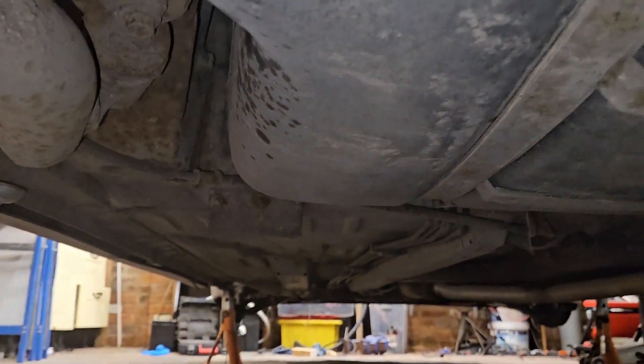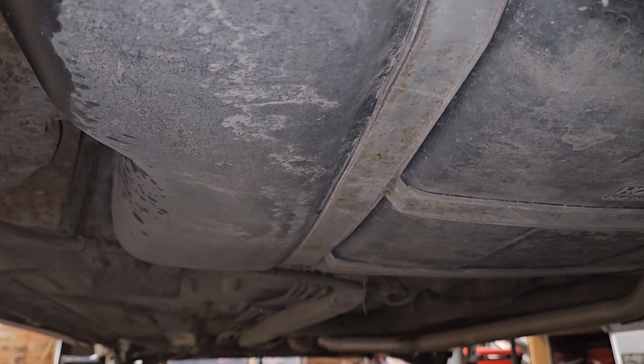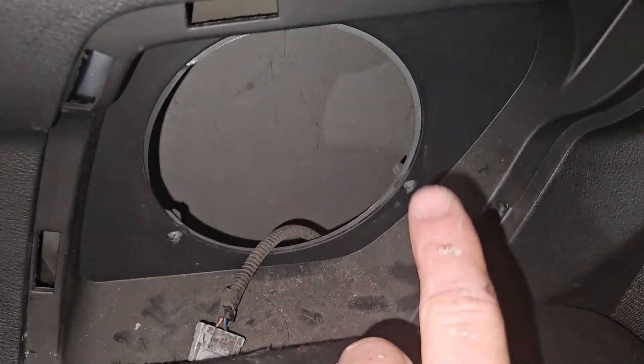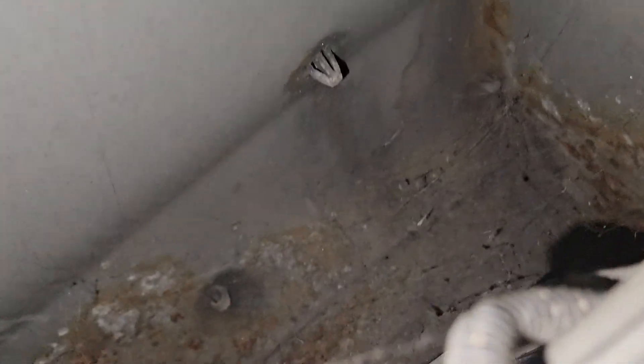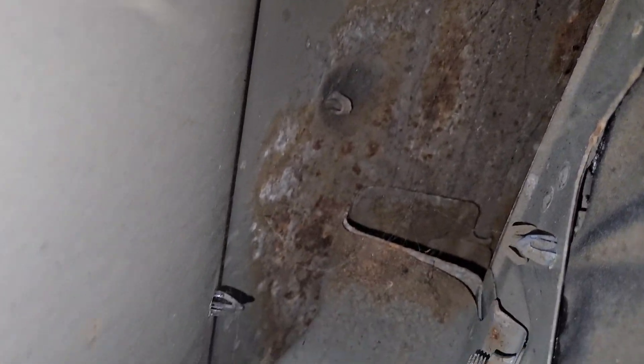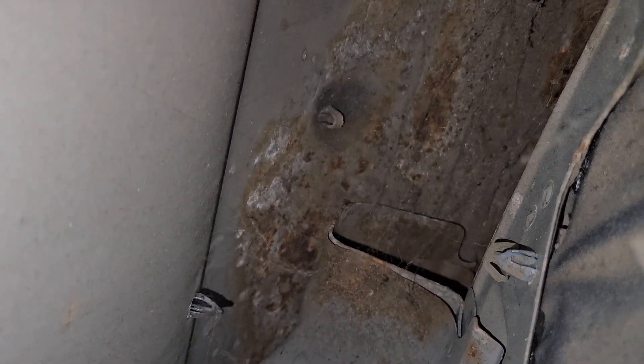It looks like we haven't bought a dog, so let's put the camera in the speaker holes and see how they look. For those unaware, one of the key places to look on an EP3 Civic is behind the speakers — you take the cover off, three screws, turn your torch and camera on, and you get ready to see whether you've got a good one or a bad one. This is the driver's side. That looks like a lot of surface rust — I'll get a rust treatment on that and then give it a sealant. I'll get a screwdriver in there too to make sure it's solid, but it doesn't look too bad.